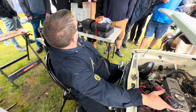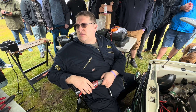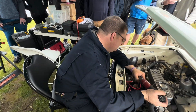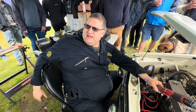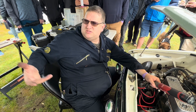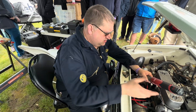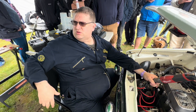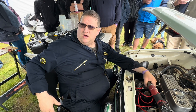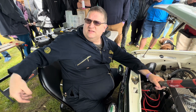It's the gap that's wrong. And that's my point — none of you know anything about gaps, and yet it's in your manual staring you in the face every time you open it. People just get a plug, take it out of the box and think it's fine. It's not fine. The gentleman fitted these last night straight out of the box without gapping them. I get paid good money to gap plugs — but you can gap your own, folks.